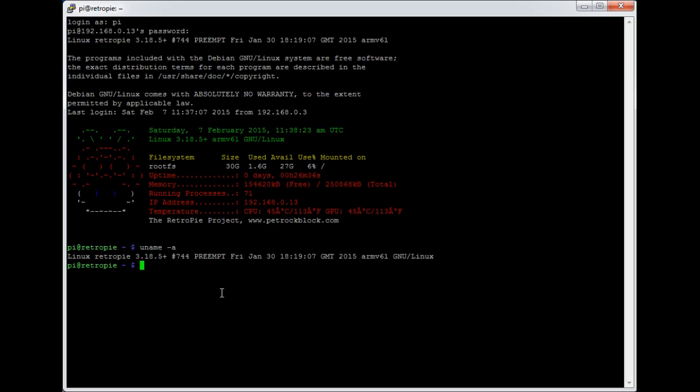And it's easy to update the old one as well. If you want to keep the one you've got at the moment, but in the future you're going to move to a Raspberry Pi 2, then you can easily update the image and just copy it across, or use that same SD card when you put it into the Pi 2. If you've got an original Model B, it will be using a full-size SD card, and obviously the new Raspberry Pi will use micro SD, so you might want to get ahead of the game and put it in an adapter and get a micro SD ready, but that's not too important.